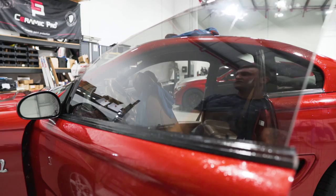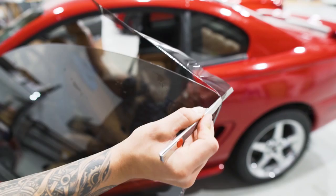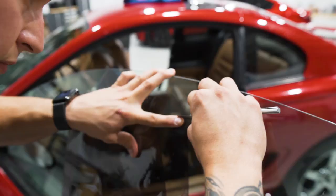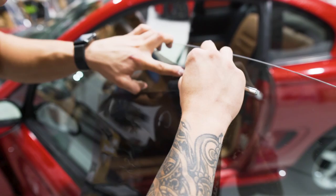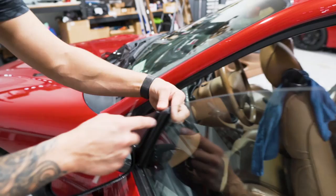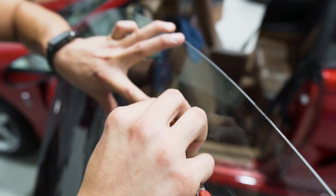No fingers pop up, so you don't have to shrink this on the outside. Then we can go ahead and cut the top edge, trying to continue with this curve here, and we'll clean that up with the final cut. With the front edge, I like to use as much material as possible, cutting off as little as possible. Because you have this little area here that protrudes forward a little bit, I like to keep that same thing on the front so you don't see a gap from the inside. We'll continue the top edge and round that out nice and big — that will be perfect. Then clean up the bottom edges.